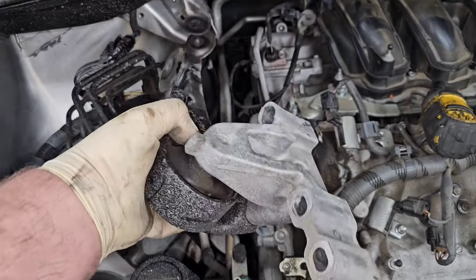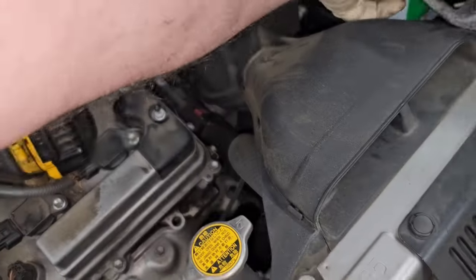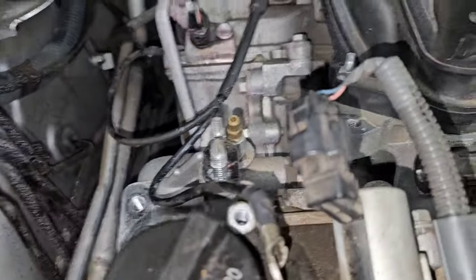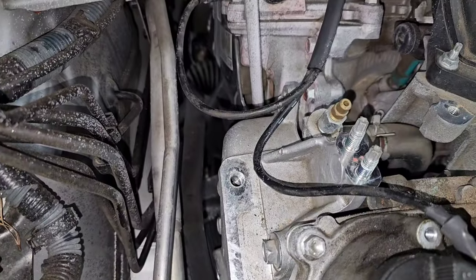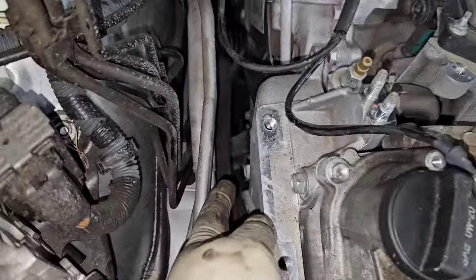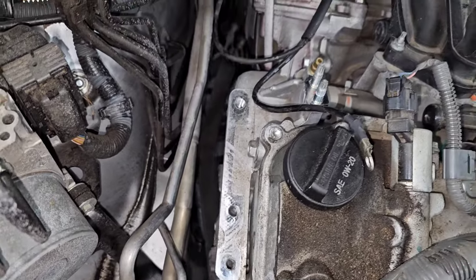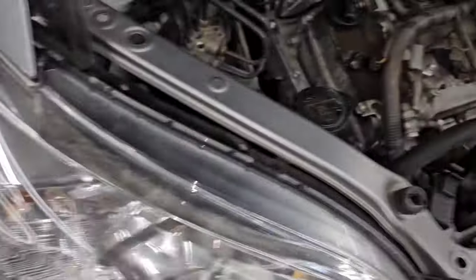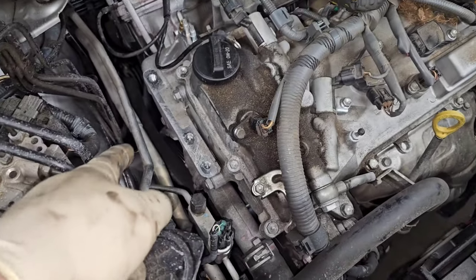So back under the hood — the upper mount here, you just take that out. It was three bolts on this end and one bolt on that end, no big deal — comes right out. Take this bracket out here. I've never done one before, so I'm thinking this is what I need to do. I believe this motor mount support bracket has to come out too — looks like a 14mm here, a 14 here, and a 14 here, which you probably have to wrench them all out. I do have the cradle loose, with a jack underneath holding it up, so I can manipulate it a bit.